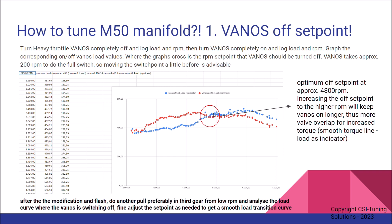This is roughly an increase of 600 RPM compared to the stock ECU setting, which is tuned for the M52 manifold airflow. It actually raises the RPM limit a bit for the M50.